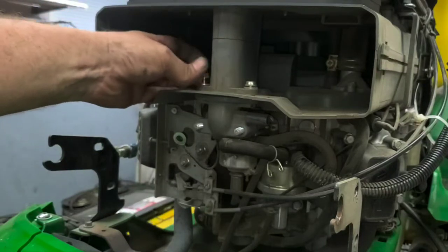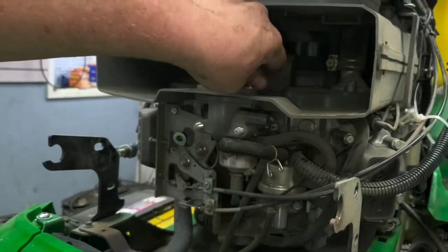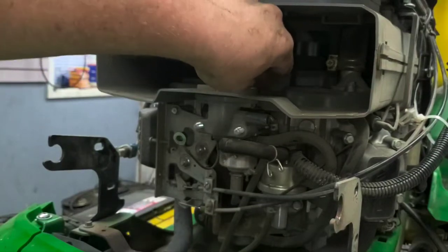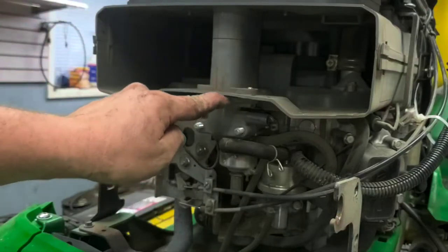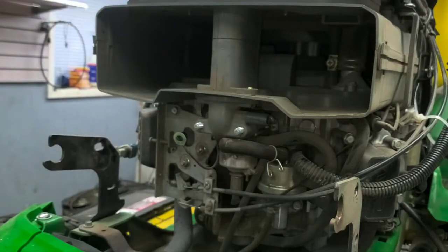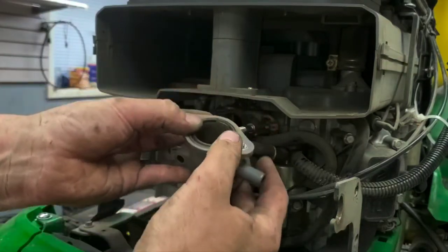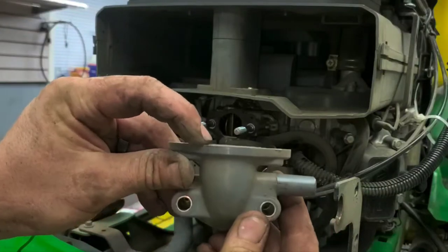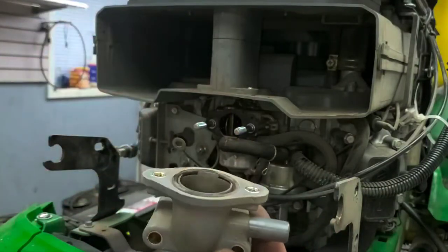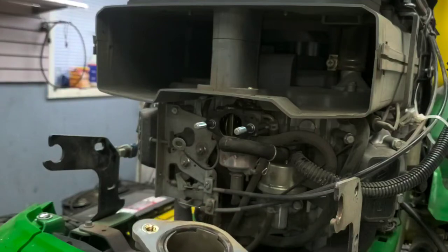So it is an important area, because otherwise you suck dirt in there and that gets into the intake, goes down into the engine, and ultimately, you know, premature engine wear. But in this case, the O-ring sits up far enough, not an issue. That's why I like doing it this way. It's a little bit easier, it just slides right out. So that O-ring, as long as it's up above where the plastic is, and this one is, they usually stay pretty rigid for pretty long. So as long as that's the case, they stay sealed there.